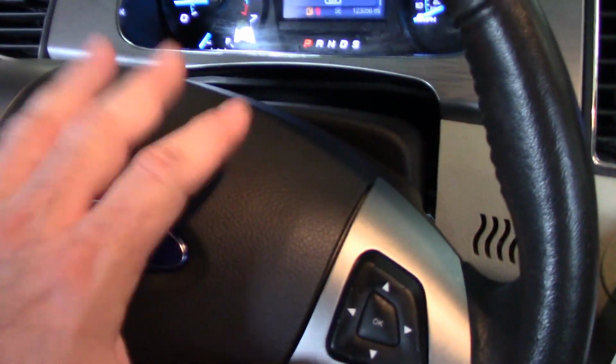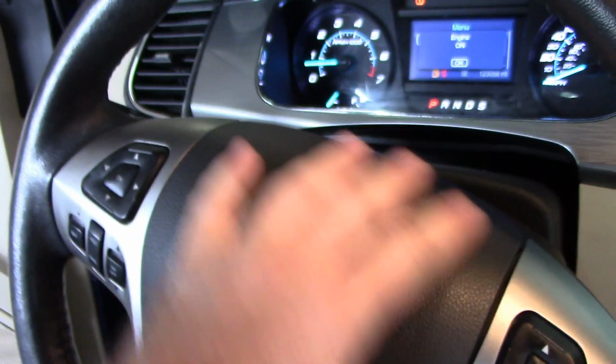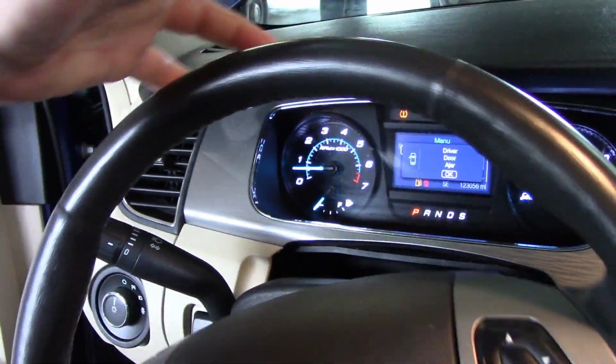So originally, on the gear, it only had 3 lines of code. So I manually put it in to make sure. That's what we were in for. I want to make sure it took. And then the SCCM, steering control module. I didn't know what the acronym is. It's a module behind the steering wheel. It controls all these switches on the steering wheel and turn signals and all that. Anyway, it wasn't programmed. I don't know if they put one in on their own or what the situation was, but that thing had like 15 lines of code. So I did the automatic on that one and just let it take it right in. And we got all pass, and that's what we're after. And now we have plenty of assist. We can steer it with our pinky.